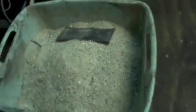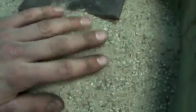And I had brazed that, and it's now sitting in this bucket of sand to cool it slowly, because if you cool cast iron too quick it will crack. So that'll be hopefully ready in the next hour or so. I can pull that out. And I gotta put that manifold on before I put the fan cowling on, because the side of the fan cowling covers this bolt from the side, so you can't really put the bolt in when the cowling's on.